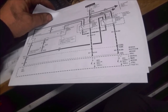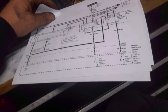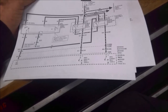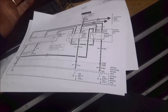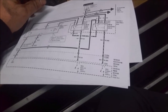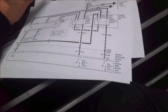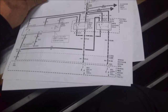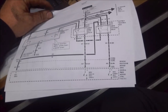So we're just taking an educated gamble at this point and assuming the motor's bad. If something else pops up, we'll do another video on how to track it down. I'm pretty confident that's what it was. I normally don't like just swapping a part out, but the only other option would be to drive around for a couple hours until it does it, then get back to the shop or take tools with me. From what I understand it would do it and then a few minutes later work again — more than likely the motor's getting hot, shuts off, then turns back on. So that's what we did — changed the motor out as an educated guess.